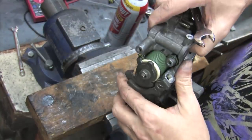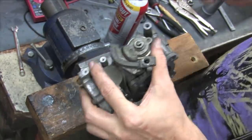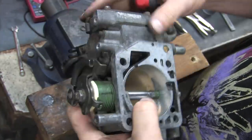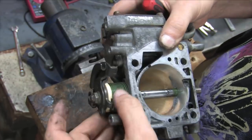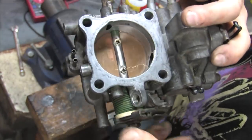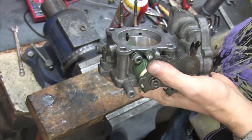If you got the ends of the twin springs crossed up in the throttle linkage, you'll be able to tell. They won't look right, and they won't be touching. You can grab it with a hooked pick and straighten it back out. Without a throttle switch installed, the throttle plate can stick shut. You'll feel it being sticky, and it's especially bad at the pedal if this isn't set right.